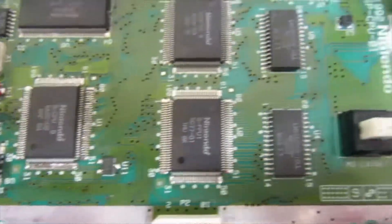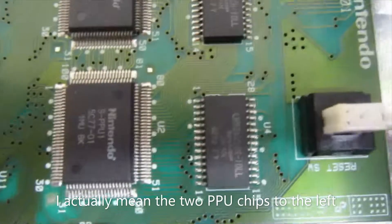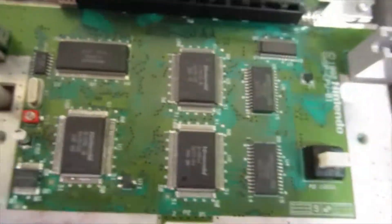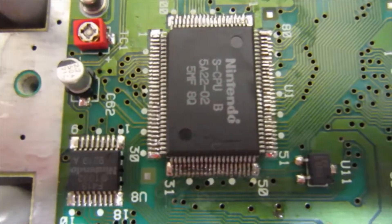In the article he mentions how these chips can go bad, but generally they'll just cause graphical glitches — the game logic won't be affected, so you'd still be able to play with graphical glitches. But if you're getting this, it's the CPU chip causing the graphical glitches.